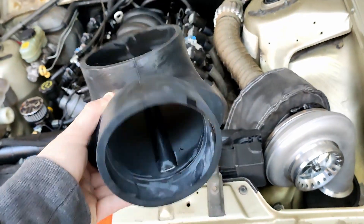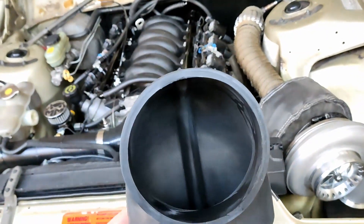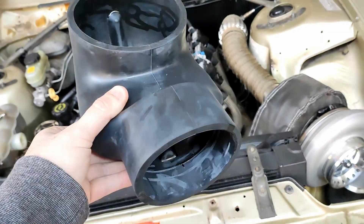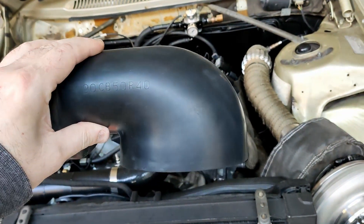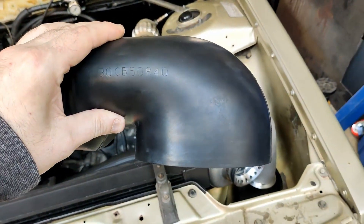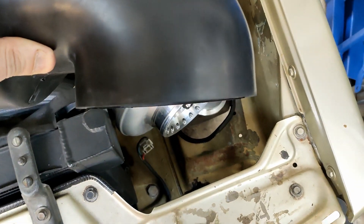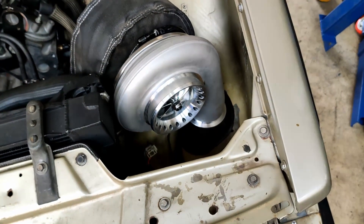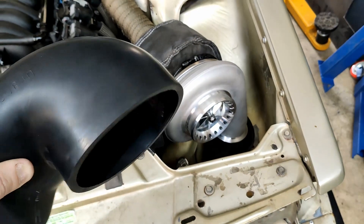It's five inches on the top, four inches on the bottom, and it's flared out so it doesn't reduce volume. Not that it would matter too much, but it's nice to know they've designed it that way on purpose. This is slim enough that you can fit it on the front of the turbo in a Commodore, cut a hole, and run a big filter below instead of having a tiny little filter on the front of your turbo restricting its airflow significantly. It's a really good solution and I wish more people would do it.